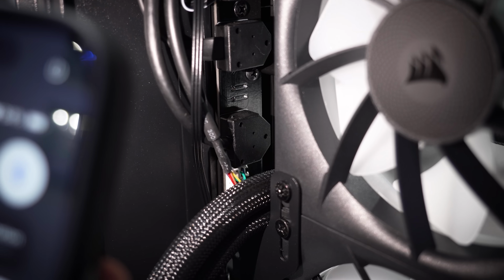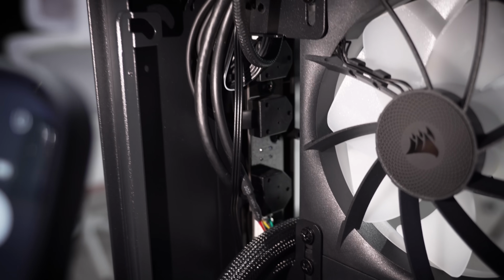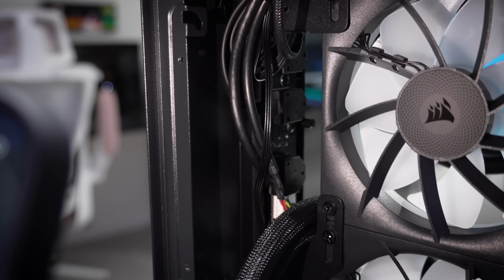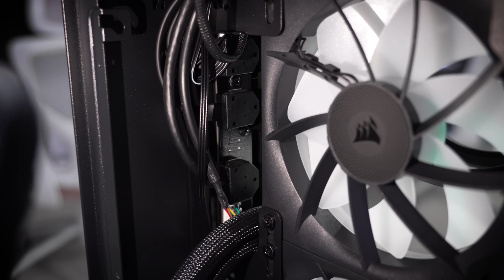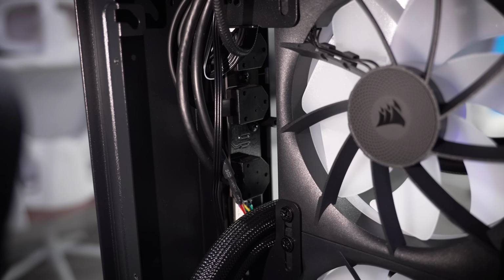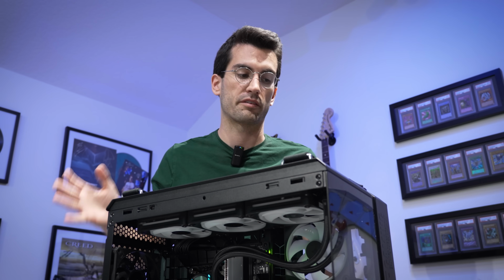Yeah, you can see there, even if I was able to narrow down whether the connector or the cable was bad, there's no way to go about swapping that out without replacing the entire front panel board, which isn't expensive by any means and wouldn't be a laborious task. We might even be able to get ASUS to send one. The good thing at least is this isn't a totally debilitating issue. Once the Type-C cable is disconnected from the motherboard, things work fine.